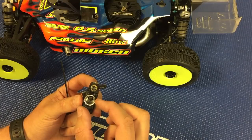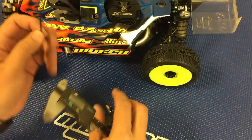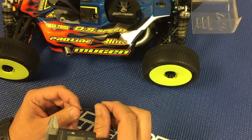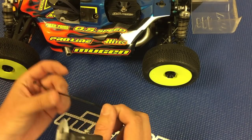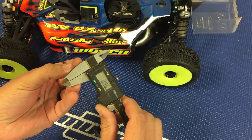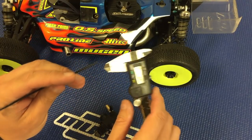With no venturi in the carburetor, you need to take something like a zip tie or you can use like a sway bar wire. I like to use a zip tie just because it's a little bit softer — it can't scratch or damage anything. The main thing is you just want to find something that is right around 0.45 to 0.50 millimeters thick.